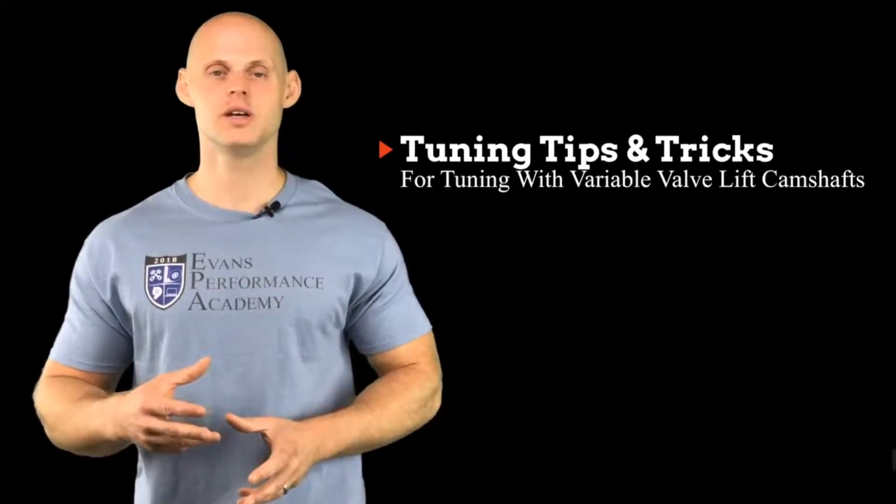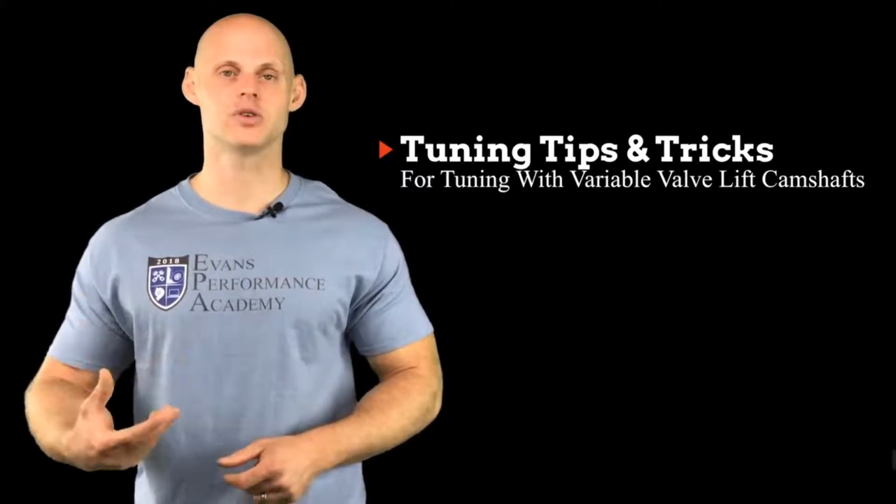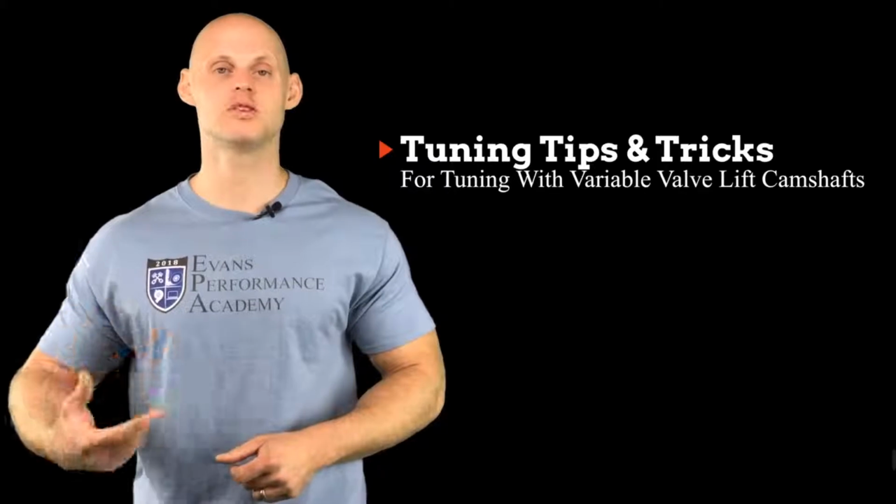Now, another thing to keep in mind is if we're tuning a forced induction engine with this VTEC function, and it's a turbocharged engine, we can manipulate this variable valve timing point and change it so that we can aid in the turbocharger spool. If we can get onto that high cam sooner, we're going to be moving more air mass in our engine, and therefore we're going to have more exhaust air mass in our exhaust manifold. That's going to build a bit more pressure, and it's going to spin the turbo faster.